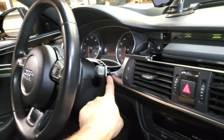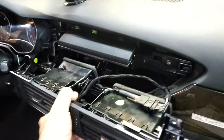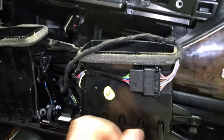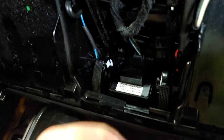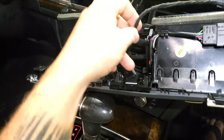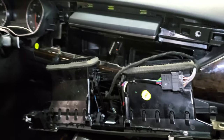Be careful not to break the trim piece as it comes out. Pop out that little tab that connects into the assembly. There's a wiring harness — one connector on each side with a little tab you push in and pull out, one with two little tabs you press in and pull out, and one small one you might need a pick to release. On mine there was tape holding the wire to the air vent — I cut those pieces of tape to completely remove it.